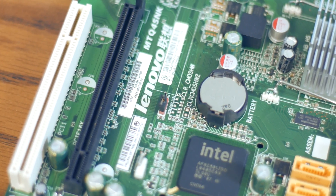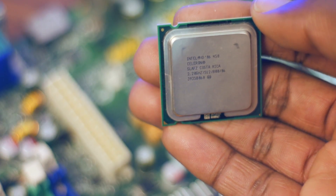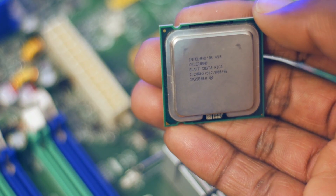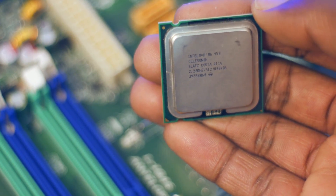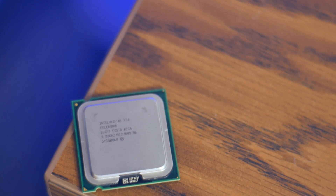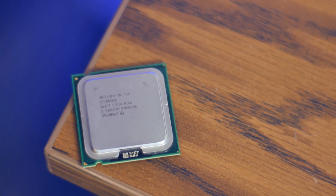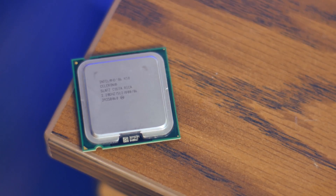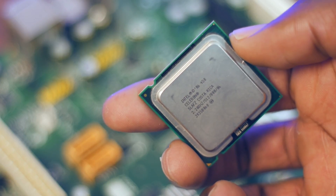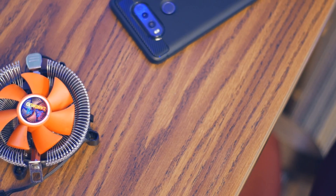Paired with the OEM motherboard, I have the Intel Celeron 450, a single core, single threaded processor clocked at 2.2 GHz. I understand that the CPU will harshly limit the games or applications I'm able to run, but for only $1.25, it was a no-brainer for this project. I'd imagine games from 2006 and prior should run fine on the processor, with the computer struggling more with games released in the last decade. Unfortunately, I cannot overclock the Celeron, although that wouldn't really do much because of the OEM motherboard and generic Chinese LGA 775 stock cooler I bought for $3.90.